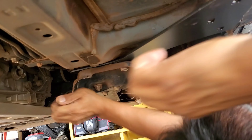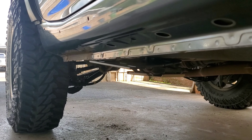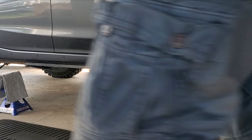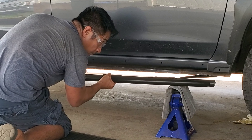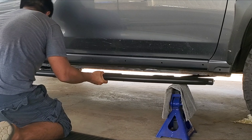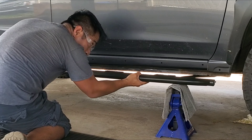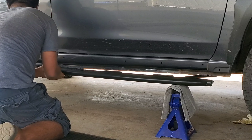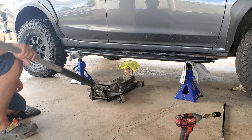When done it should look like this — they'll be a little crooked since they're loose, but they act as a shelf to help hold the sliders up as you align the pinch weld to the brackets. You can use jacks or a friend. Use jacks first to get good enough support to set the length and positioning of the sliders. Take your time and measure a lot before you cut, because once you drill those holes you're stuck with them.